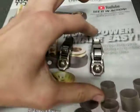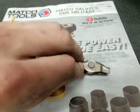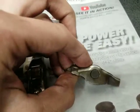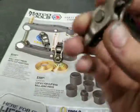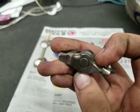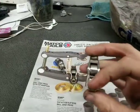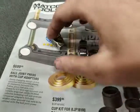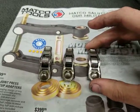This is kind of just a beginning phase — it's on its way out. You can see the needle bearings aren't gone but there is a lot of play in the roller. So yeah, that's just a real quick look at three different types of 3.6 Chrysler Pentastar V6 rocker arm failure.